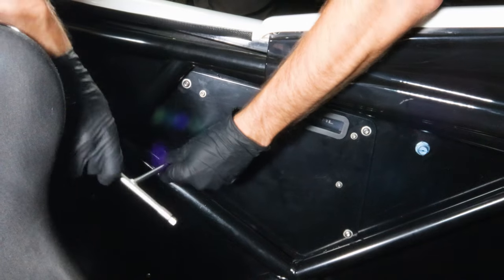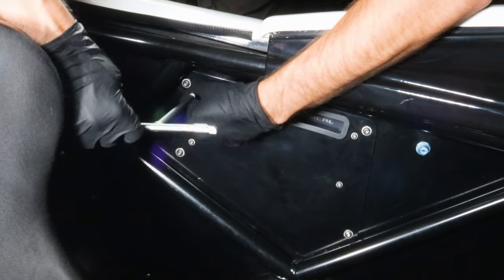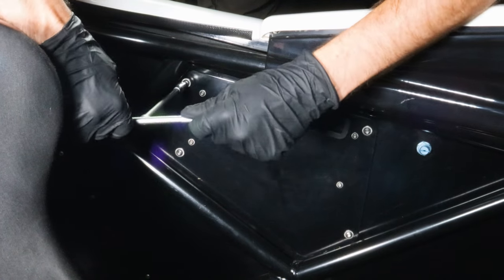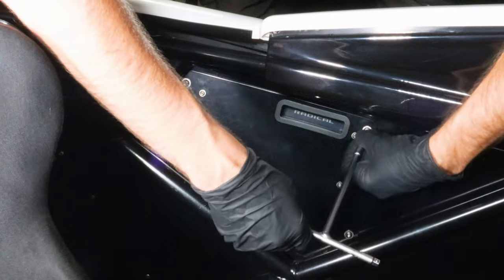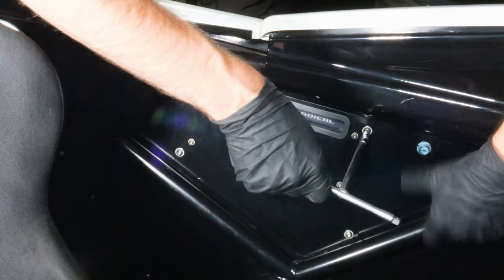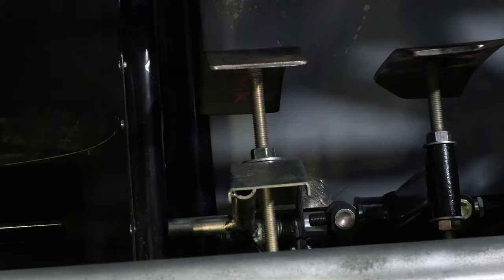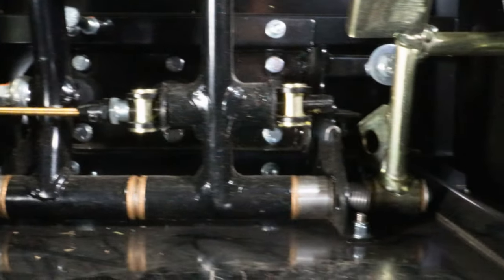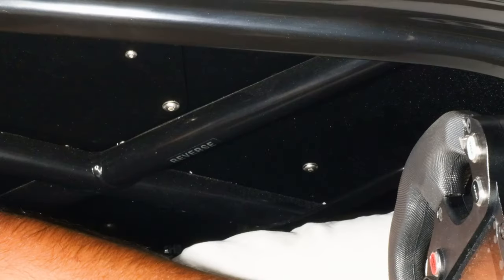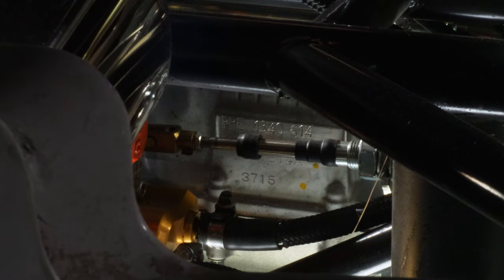Check all side panel covers — this will include the ECU, fuel cell side plates, seat side plates, and floor mounts. Check that the pedal extensions are not loose or turned the wrong way. Make sure that the throttle cable is not rusted or frayed. Have a coworker visually inspect that the reverse lever is properly engaging and moving into place. You should hear a click.